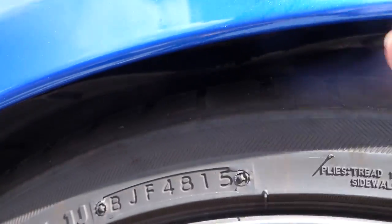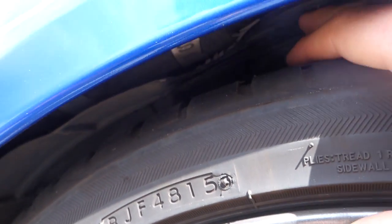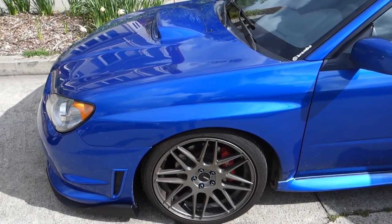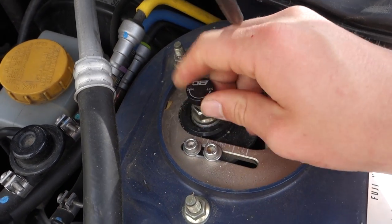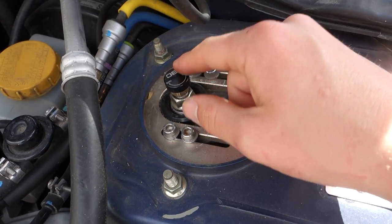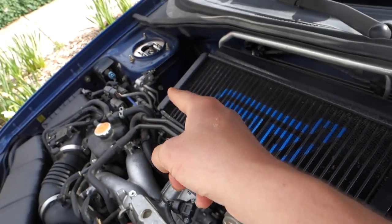Made it back to Santa Cruz. I need to adjust my dampening because I think I'm actually bottoming out — it's getting bad with this low life. I have about an inch and a half before I start hitting stuff. I'm gonna show you how to adjust dampening on BC coilovers. It says soft and hard — we need it as hard as possible. There are 30 different clicks, so I'm going to 30 and backing off two, putting these on 28.